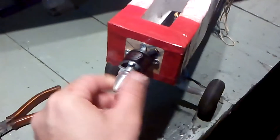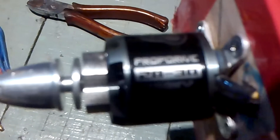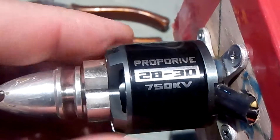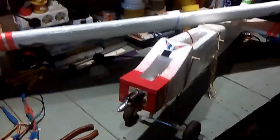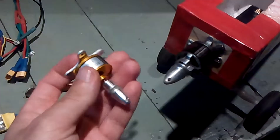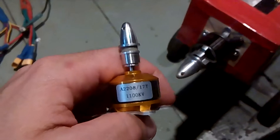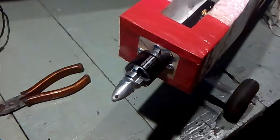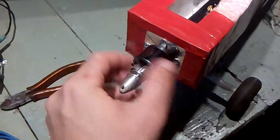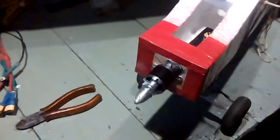In this video we're going to be changing this brushless motor, a 2830 — actually a 2837 750kV motor — on my trainer plane. We're going to be changing that for this X60 2208 17T 1100kV motor. The reason is this 2830 has too low a kV rate and doesn't have enough power for this plane.